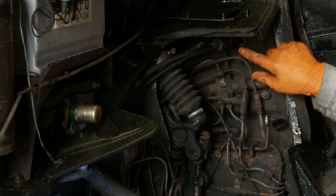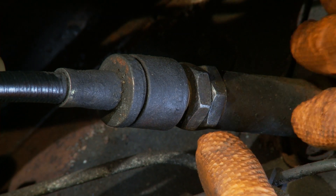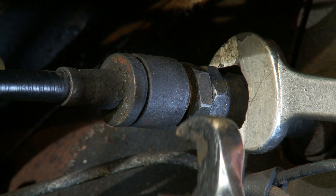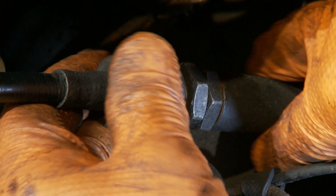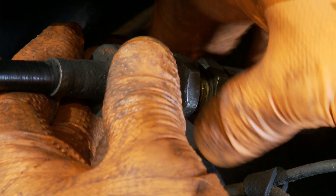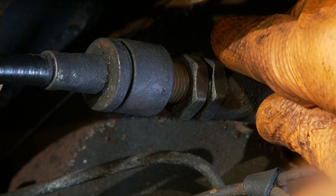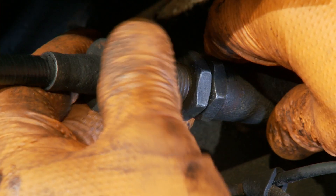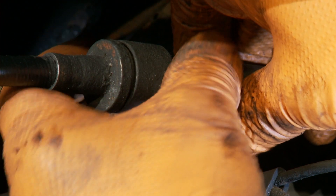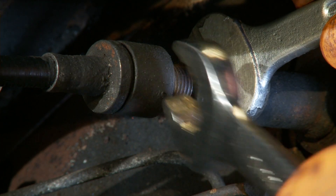Here is the parking brake cable, and these are the two nuts you need to adjust to essentially take out free play. I can move the cable in and out and you can see it's a bit slack. First of all, you need to slacken off the lock nuts against each other, and then undo the inner one, which will take up any free play. The amount of free play you want is a little bit subjective — if you go into the car and operate the handbrake, you can feel how much free play or reserve travel you've got. You also don't want to over-adjust it such that the pads are contacting the discs, so take out all the free play but allow enough play at the pads.